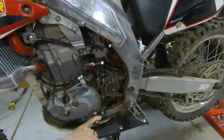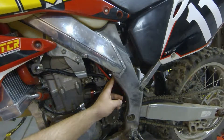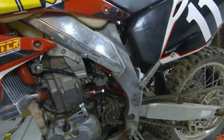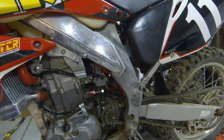Aftermarket shifter here — not a big deal. Carburetor was professionally cleaned and I put new vent hoses on it. It's really important that you put new hoses from time to time because they'll get clogged at the bottom with dirt and mud, and then you won't be able to vent and you start having problems.